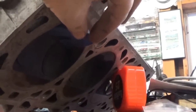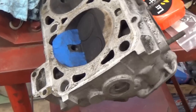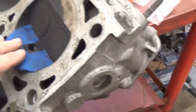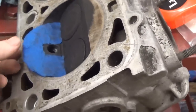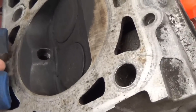Looking at another head that's off a car, I can see that with the spark plug hole pointed straight up and down, there's a small volume up at the top that will be filled with air — the oil won't reach it before going out the spark plug hole. So I've taken some Play-Doh modeling clay and approximated what that unaccounted volume looks like. I used the Play-Doh to fill this gap, and now we can see that volume that the oil method misses.